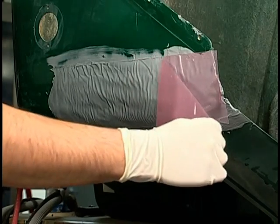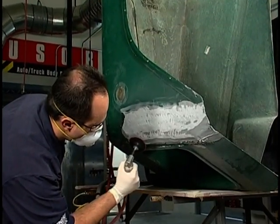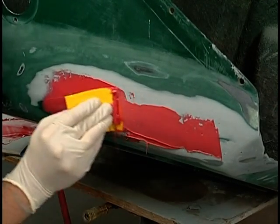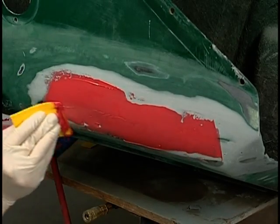After the repair patch cools, remove the plastic film and rough cut with an angle grinder to remove all excess adhesive. Finish sand the area with 80 grit sandpaper. To eliminate pinholes or minor imperfections, use Fusor Plastic Finishing Adhesive, stock number 114.